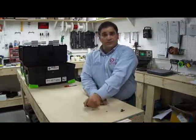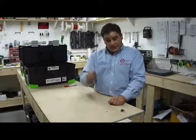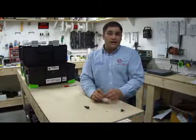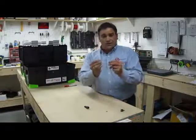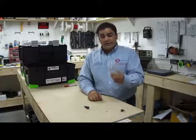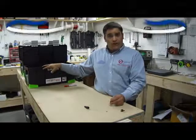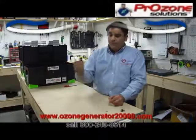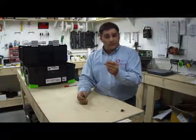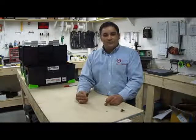It is possible, though, under certain electrical circumstances, for the fuse to not be enough. That's why in household appliances like coffee makers and hair dryers, they employ a secondary backup technology called a thermal fuse — and this is a thermal fuse. What we've decided to do in the 2011 model year is incorporate both a fuse and a thermal fuse into every Bioblaster home model and every Bioblaster rugged pro-grade contractor model, guaranteeing that if it ever gets to temperatures of over 200 degrees, it'll shut off and break the electrical circuit. That's the extra added fire protection we've added for the 2011 models.